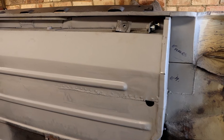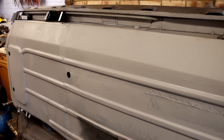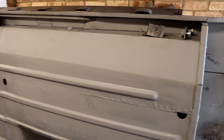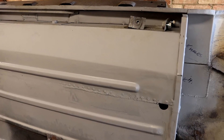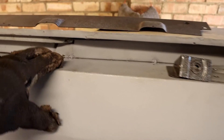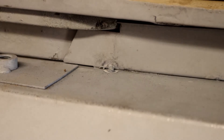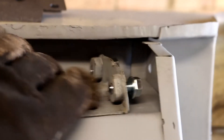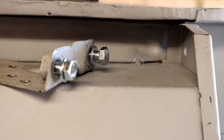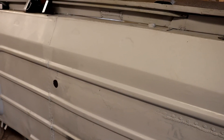I have jumped a few steps ahead. The problem is you spend all the time grinding away and test fitting, and grinding some more, and doing another fit — and when it finally fits, all you actually want to do is weld it in. So that's what I've done. Up here I did take that panel off and tack it into place — there's only three tacks there. Once it was in place I then took the whole panel out and it's plug-welded on the other side. At this end I did cut a little bit off just to make it fit easier under there, and the whole panel fitted quite nicely in the end.